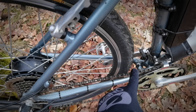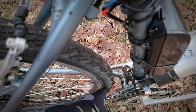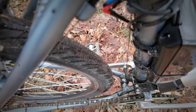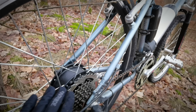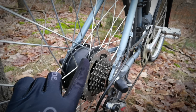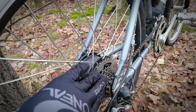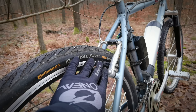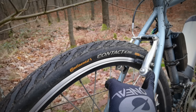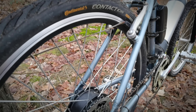Also about the chainstays: you want to have the right length of the chainstays so that you have enough space for the wheel. You want to know how many gears you have and whether you have the cassette, the free hub, or the freewheel — this one is the freewheel version. And finally, you want to know the type of the brakes. I needed a rim for the rim brakes because I don't run disc brakes on this bike, but you can easily buy something with disc brakes.